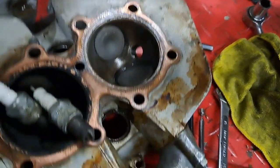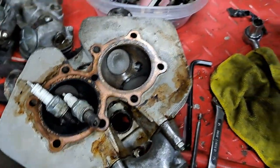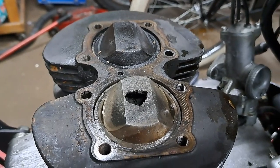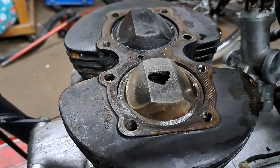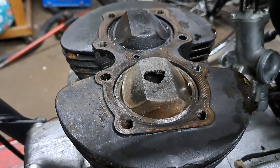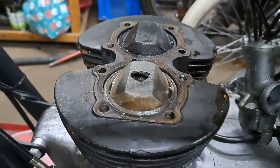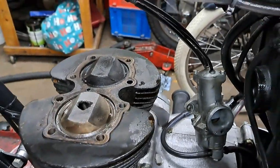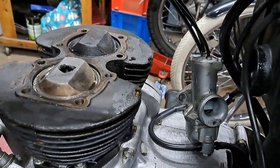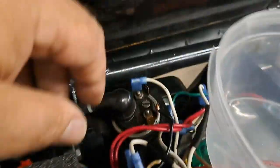With all that heat it's removed any little soot deposits, and the exhaust valve has got a nice little coating of aluminum on it too. That won't hurt the valve - I'll rub that off when I put the engine back together. The bores look to be safe; I don't see any gouging or scraping, so I probably won't have to get a re-bore done. I don't see the point of putting one piston in - if I change one I usually change both.